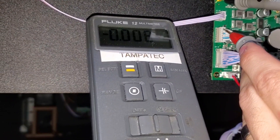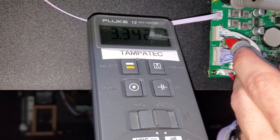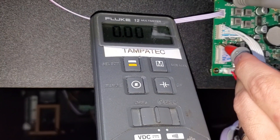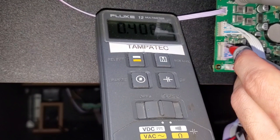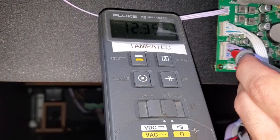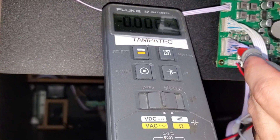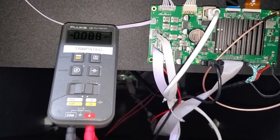I'll read it all the way down. So this is zero, zero, zero — and it could be a ground. There we go: 3.3 — that's probably logic voltage. 12 volts. 12 volts — might run the audio maybe. It tells you 12 volts right here on the board. And 12.3. 12 volts. 12 volts. 12 volts. Zero, zero, zero, and zero. That's pretty much how you would read the voltages coming from the power supply.